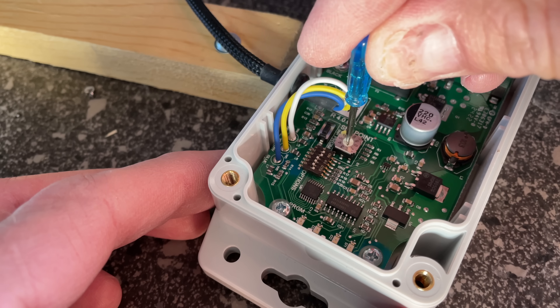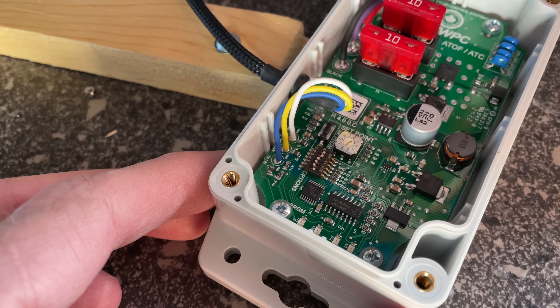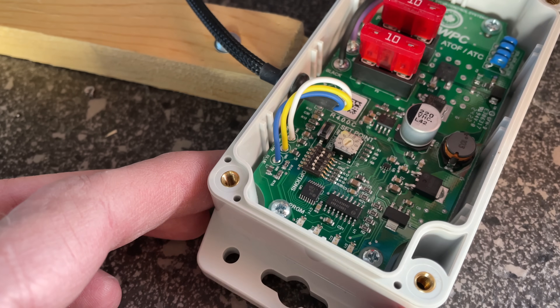The first setting you can change is the pressure inside the RV coming from the pump. The way it's shipped, it stops at around 33 PSI — that's what the dial set on position two. You can crank it up to position nine and that'll bring it to around the mid-forties, around 44 PSI. So you can pick the pressure inside the RV from the pump that you'd like.